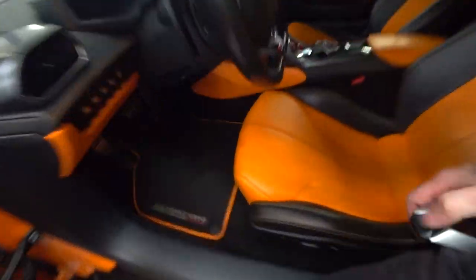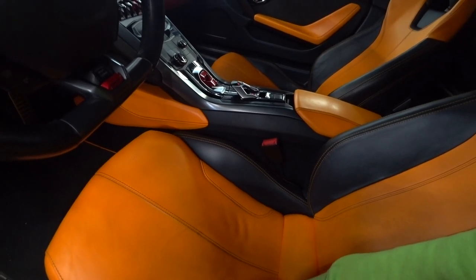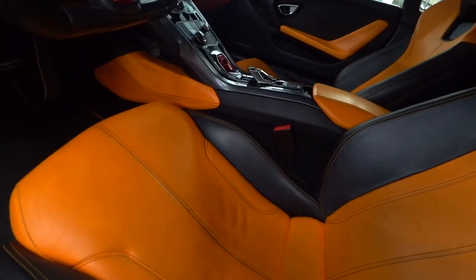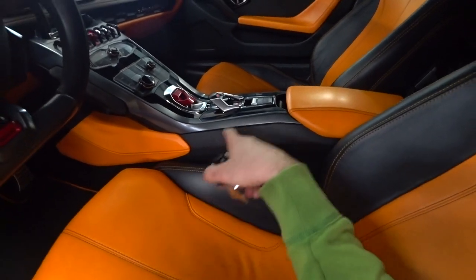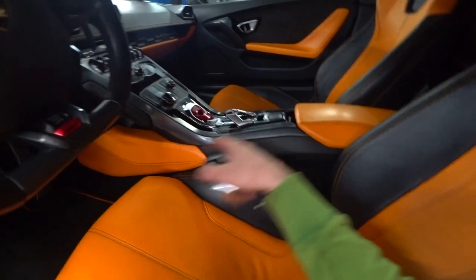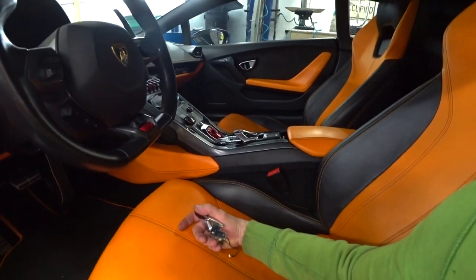About the shifter — when we shift to reverse gear, it pops a malfunction trouble code showing something wrong with that shifting module. We ordered and got the module, but the problem is this car has a black glass panel, and what we ordered has a flat black finish. We can install it like this, but we need to replace that cover. To pull out that cover, you need to disassemble the whole thing. And when we started reassembling that module, we found the problem.